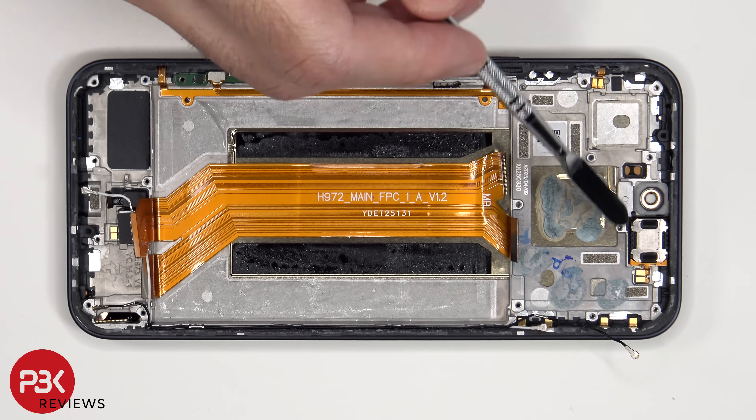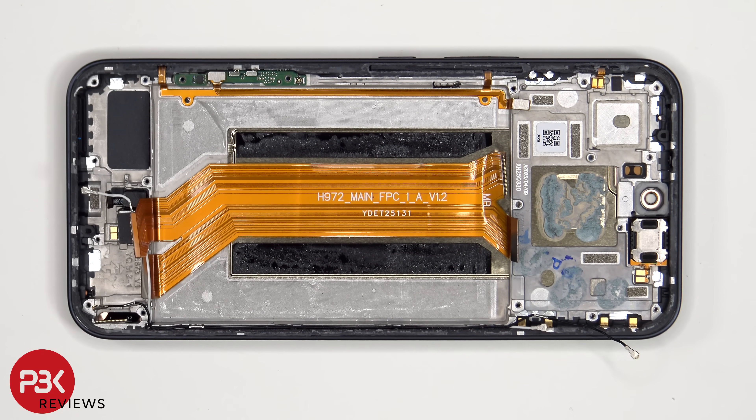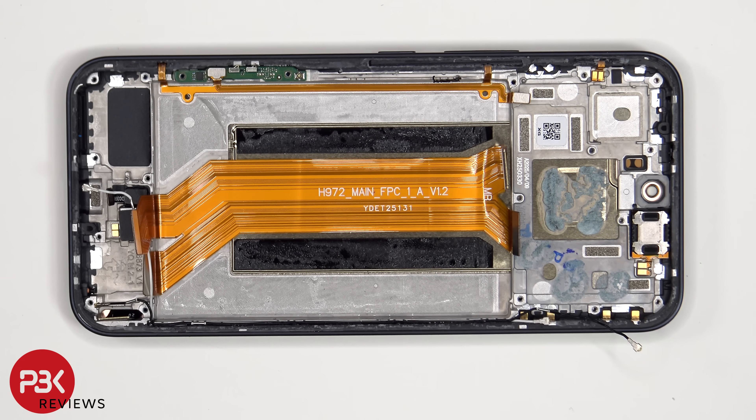The top earpiece speaker is located here, also held down with some adhesive — to replace it, just apply some heat and pry it off. When it comes to this phone, if you accidentally insert a SIM ejector tool in the wrong hole, you don't need to worry, since both the filters and the microphones are seated above the holes and they wouldn't get damaged.